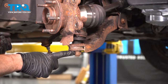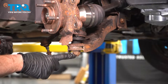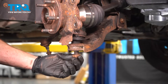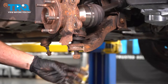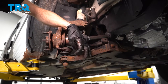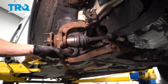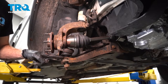Move along to your lower ball joint nut. Use a 24-millimeter socket to remove this. Start it back on there just a couple threads. And then we're going to continue by breaking the ball joint free from the lower control arm. Now we can start separating the lower control arm from the ball joint slash knuckle assembly. To do this, you can either use a ball joint separator, come up along the top here and press on the center of the stud, or just use a hammer and give it a couple loving bonks to break it free. Once it looks as though it's separating, we can continue.